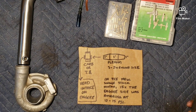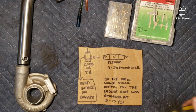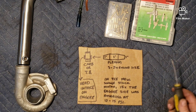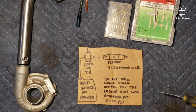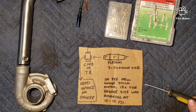On the 190 I went to 15 times the size of the motor for the plenum, and like I said it woke up the bottom end — I had not lost any mid-range and if anything picked up top end; it revved out farther. I'm actually dialing mine back to 10 times the engine size because of space constraints. Mine is going to be part of the gas tank — the front portion of the gas tank will be my plenum and the rear section will be for the gas, split, welded, and pressure tested. Plenums are not necessary for a single cylinder, but a single cylinder with a plenum will always make more power than one without.